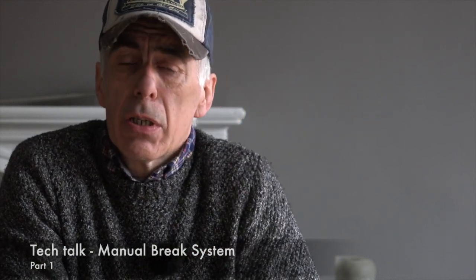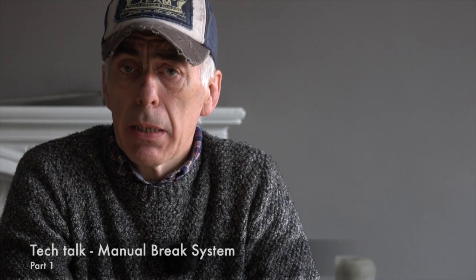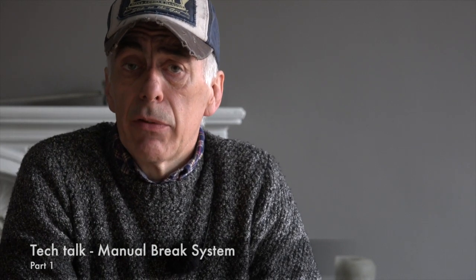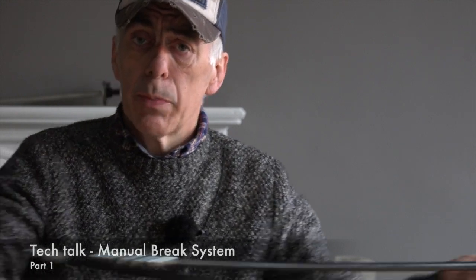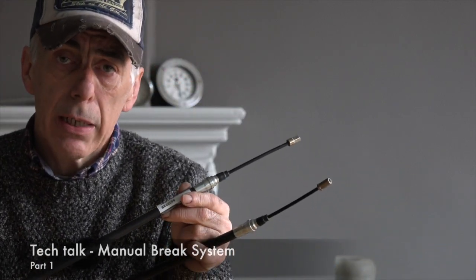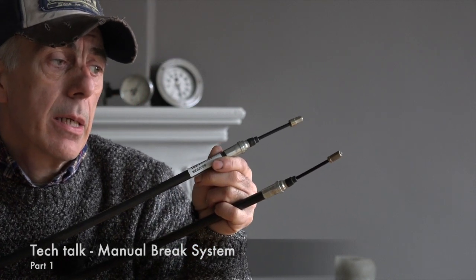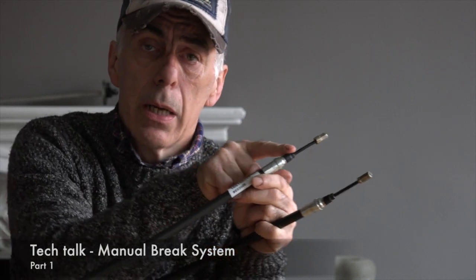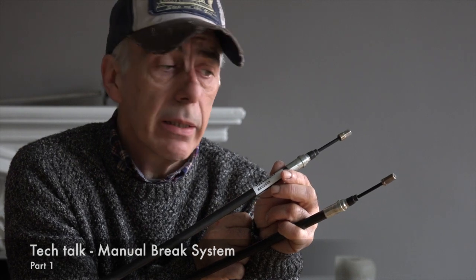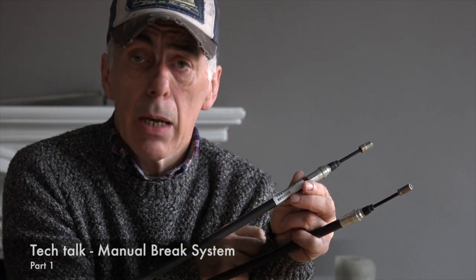The principle of operation is very simple. If you activate the manual brake in the cockpit, basically pulling it up, then the primary cable is pulled forward. If the primary cable is pulled forward, then the horseshoe basically is pulled forward as well, and then the secondary cable is getting shorter, like so, and then the cable moves in. See? And if that cable is being pulled in, then obviously the lever on the brake caliper is being pulled upwards, or activated, and then it pushes the brake piston forward against the brake disc. And this is how it works.